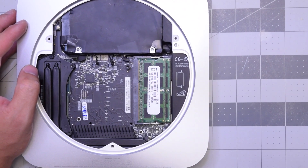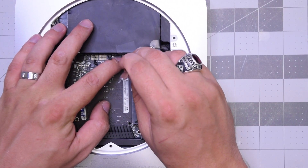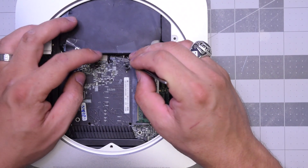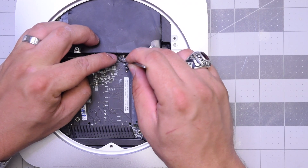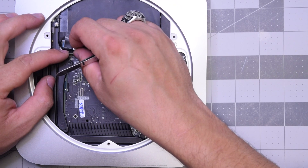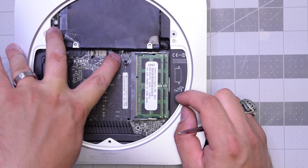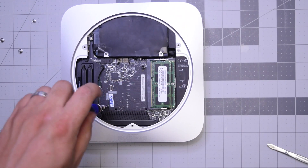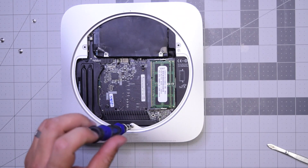Make sure you pull out any cables if they're jammed — we're going to go one by one. There should be six connections here. Start with the first two ribbon cables, popping them into place, then the sensors from the hard drive and from the optical drive as well. Once those are in, go ahead and plug in both the hard drive and the optical drive — make sure you hear that click and they're firmly in. Check all six connections before you proceed; there should be one, two, three, four, five, six — and then the seventh one is the fan. Go ahead and pop in that screw securing the logic board, the T-screw, and then the last T-screw as well.